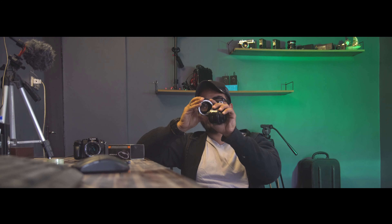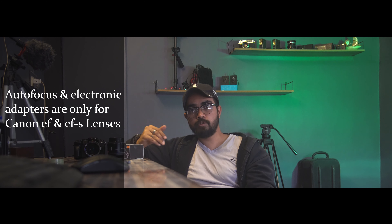There will be communication points so that the lens aperture can be controlled by the body. So these are the three things: speed booster, manual lens adapter, and electronic adapter. You can find these for mirrorless cameras. Note that Nikon in electronic form will not allow any third-party company to make communication-capable lens adapters.